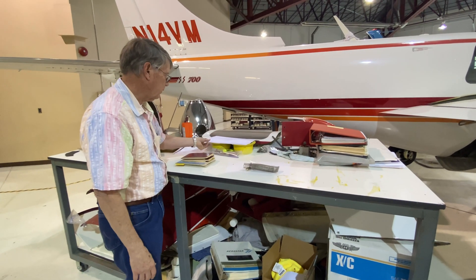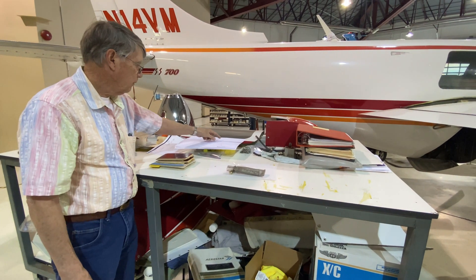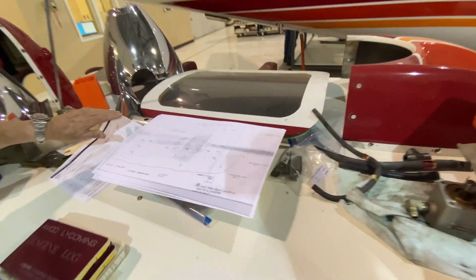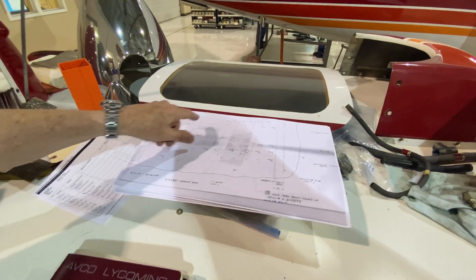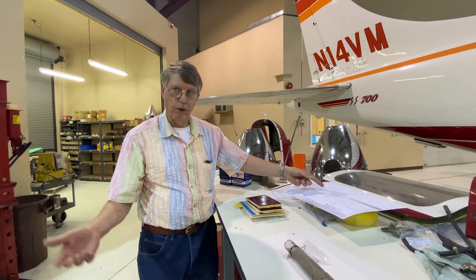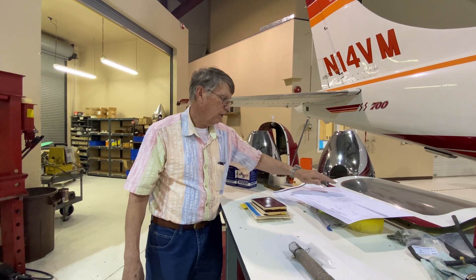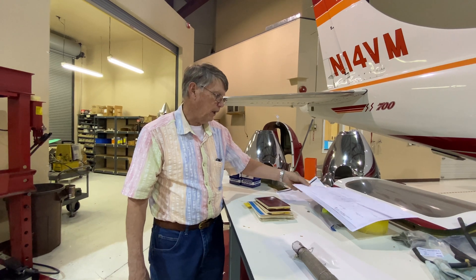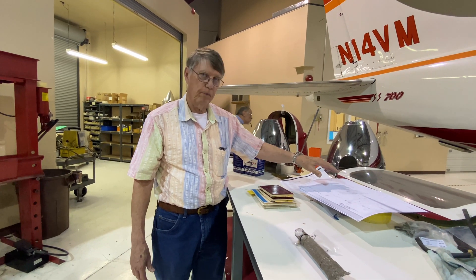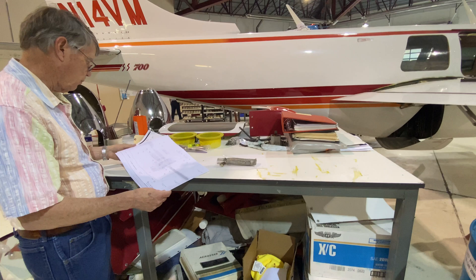Those access holes — like this one here — were approved on later airplanes. Your airplane has this access hole and there's no cover that goes on it, it's wide open, but it has a great big doubler around it. On any airplane, if you cut that hole in there you can't just say there's plenty of margin in the wing skin and it's not going to be a problem. Do you want to pull the loads on the wing and find out if it's a problem? No — you have to add back in enough structure to carry the loads that the piece you cut out was carrying. The person who determines that has to be a designated engineering representative. It's always easier to just add the material back in and carry those loads than to try to analyze it and say it's still okay.